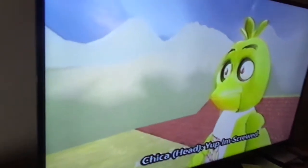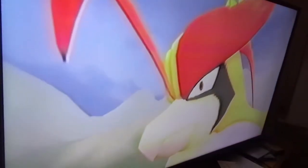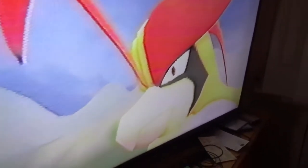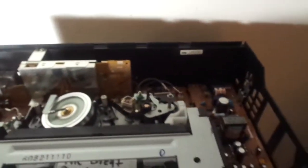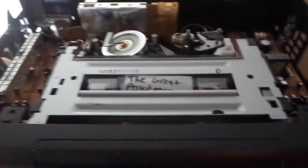Now I'm just going to press play. I decided to test the pause feature — this has a really good pause. I recorded this on a vintage 80s four-head VCR. Most of the time when I pause a tape recorded on a two-head VCR there are lines of static, but this one has a really good pause. Sony always makes some of the best stuff.